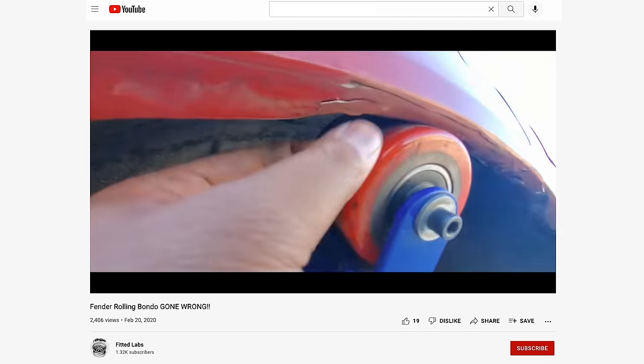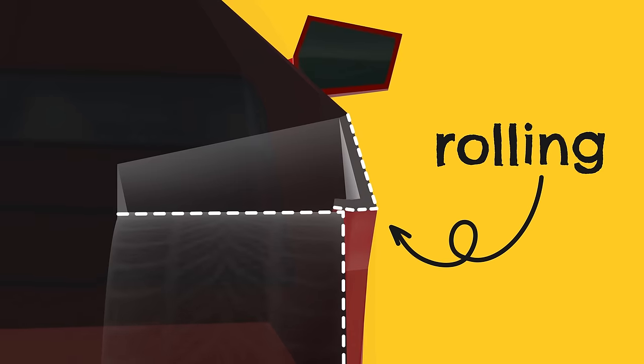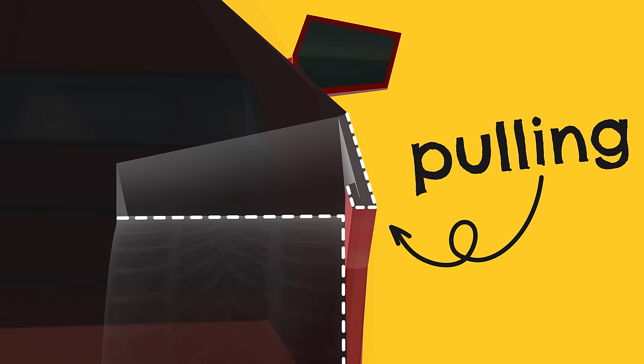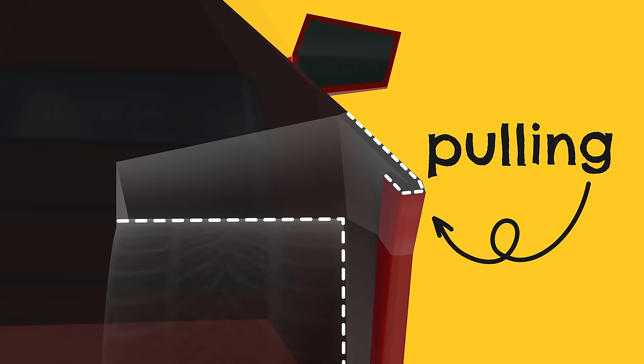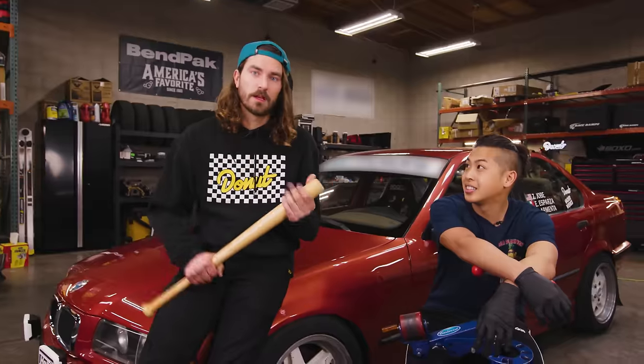It's probably pretty easy to crack your paint. The paint is the number one thing. So what's the difference between fender rolling and fender pulling? Fender rolling is literally just folding the lip against the panel, and pulling is bringing the fender out and actually changing the exterior look of the car. Now that we know the basics, I guess it's time to get this show rolling.